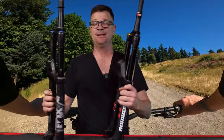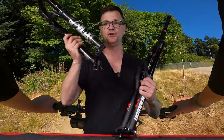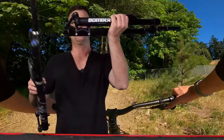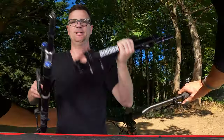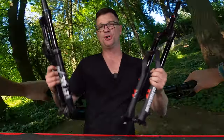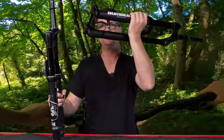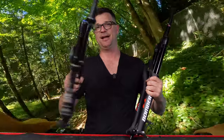Materials aside, and besides the M logo, they're almost identical. They're 180 millimeter rotor direct mount, so you need a 20 millimeter adapter to run 200 millimeter rotors. These forks aren't particularly good with 220 millimeter rotors because you have to run a plus-40 adapter, and then you start getting flex.